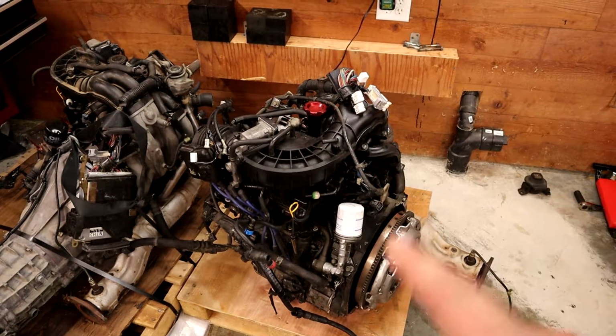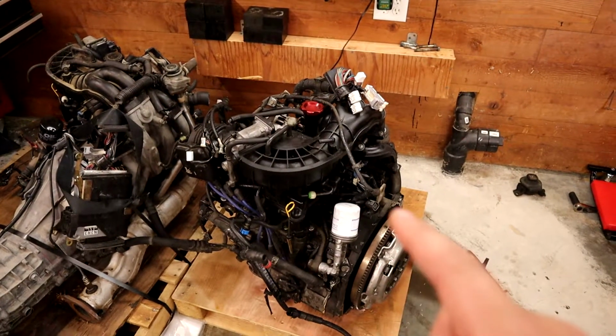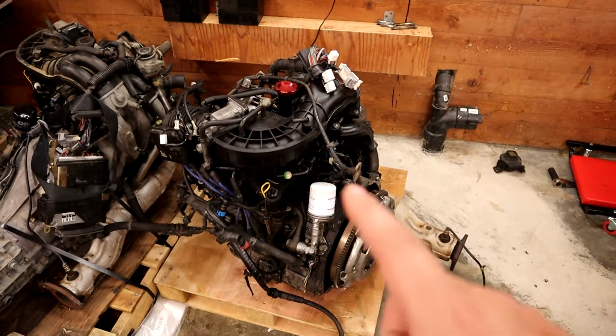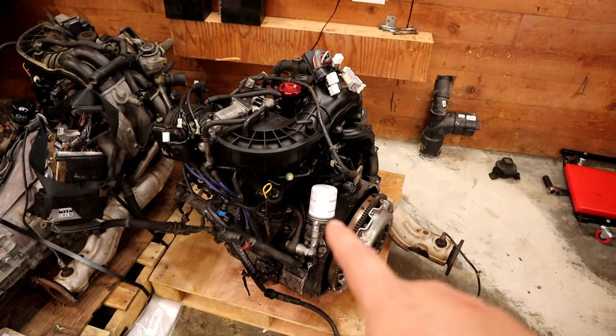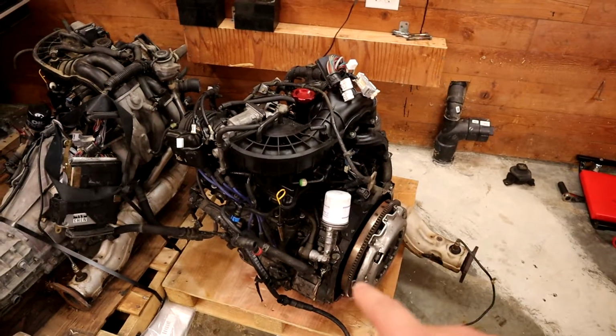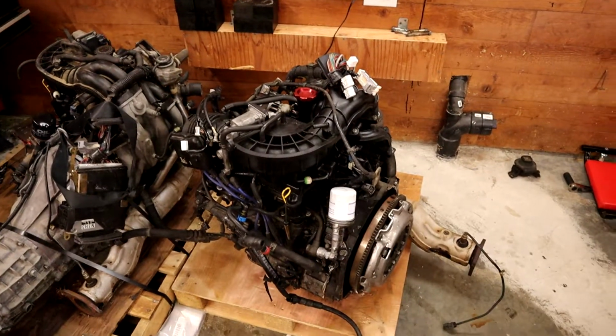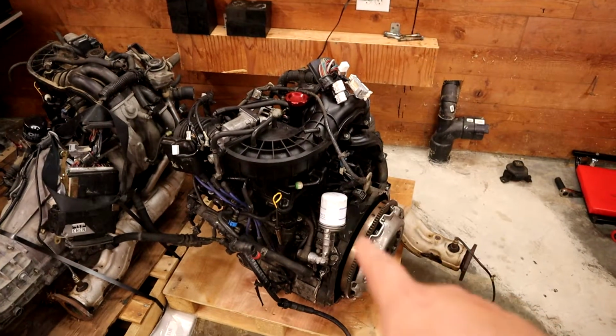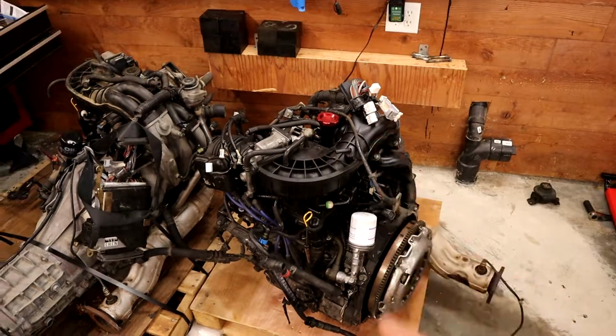And then when we started driving it really hard, the apex seals ate themselves and possibly our rotor housings and other things. Also, when we drained the oil, we saw some bronze metal particulates, which may mean our bearings are going bad in this thing. So we're basically bought into a full rebuild on this engine. Which brings us to this.